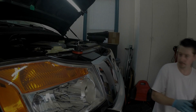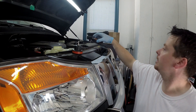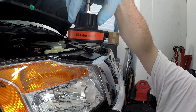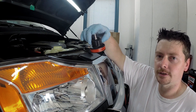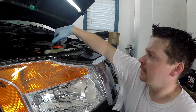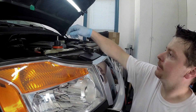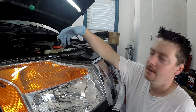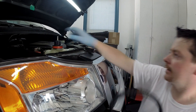The truck's up in the air, I just popped the radiator cap off. The cap that fits this truck from the Astro kit is the orange 78210-06. What's really nice is you've got an actual cap for your car — there's a chart in the instructions telling you which cap fits which car. The one that didn't come with the kit was Land Rover and late-model BMWs. I did order that, it was only about $20. It's a pretty high-quality kit.